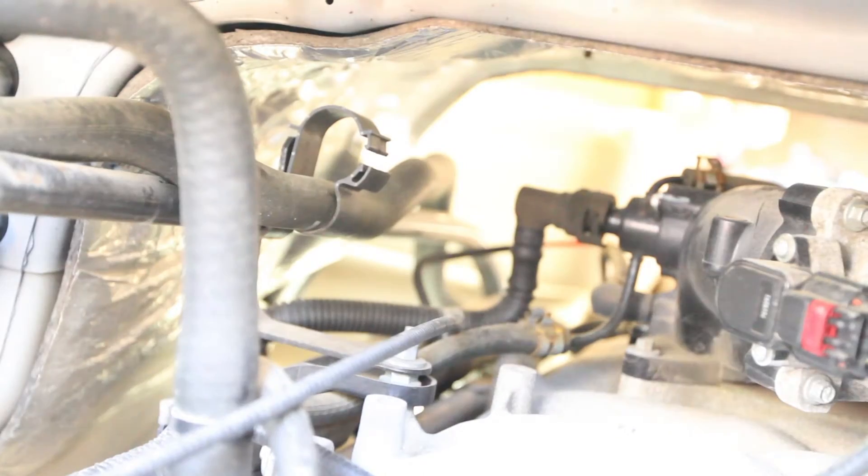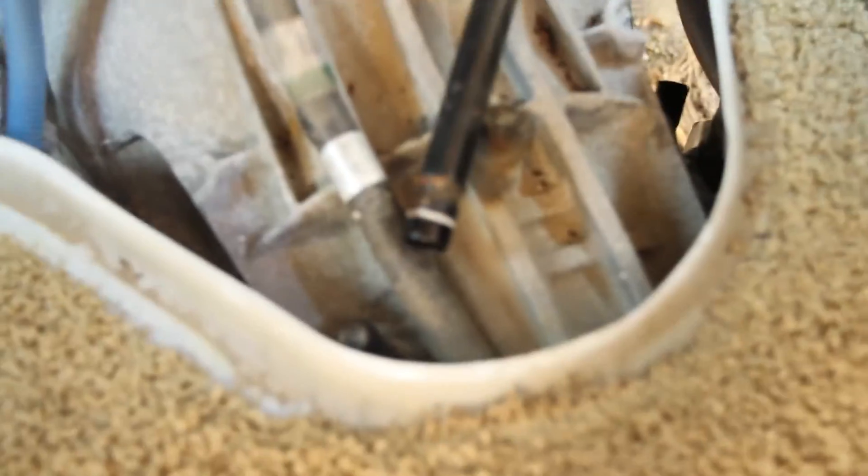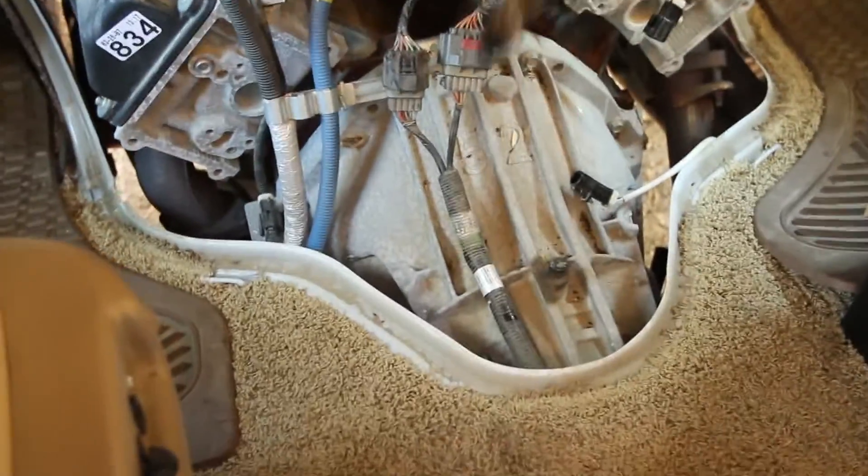That's the second nut to remove, and then the tube should be free. I tried pulling it out from the engine side, but I don't think you can get it out that way. From inside the vehicle, you should be able to pop the upper tube out from the lower tube. There's also one electrical connector you need to remove — there's a little thumb tab you depress to pull it apart. With that out of the way, rotate the tube clockwise, bring the bottom part up towards yourself, and thread the tube out from the engine.